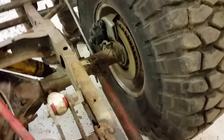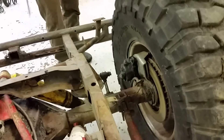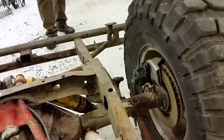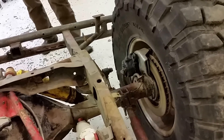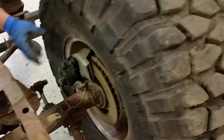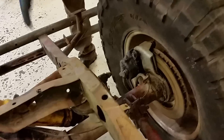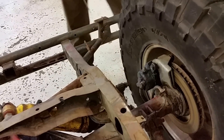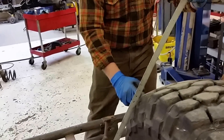Next thing is a good shock right about here that does its job — comes up through all the crap. I think of all your bars and whatnot, get the shocks in right and then we can figure shock placement. This is now your prototype. The brakes have got to move up here, clearly. We've got to get the shock mount set up so when I put the 44s on, when I articulate, I'm not eating the shock mount. Because if you saw that before when this thing tipped over, if I've got a shock mount here, when it articulates, that thing's going to be close — it's going to be in the tires.